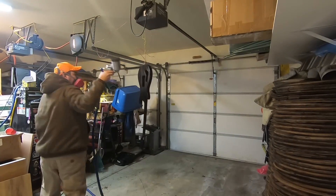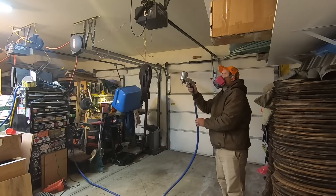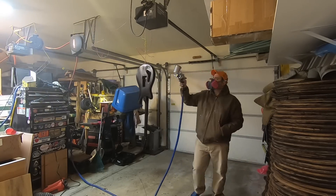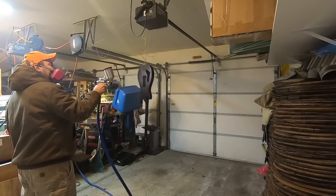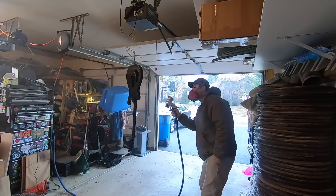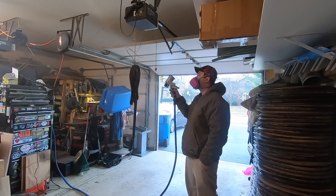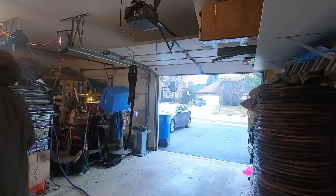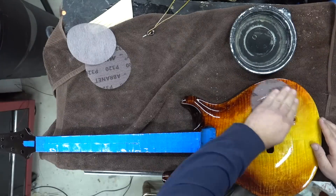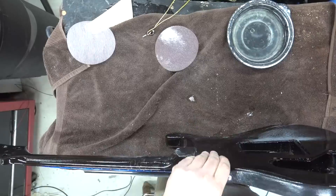This was earlier in winter. One nice thing about 2k is that you can spray it in the winter. We put the final coat on here — I've got a respirator, full jacket, spray and open the garage and air it out. The trick with 2k so you don't get any bubbles is to put on a dry mist coat, sort of like 30 seconds of spraying. Let that dry for about 30 minutes, then put on a full wet coat. Wait another 30 minutes, put on the wet coat, then wait a whole day and let it dry. Then sand this down — wet sand it.